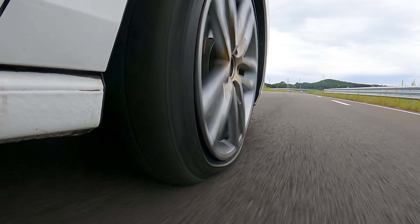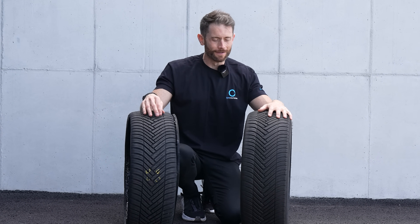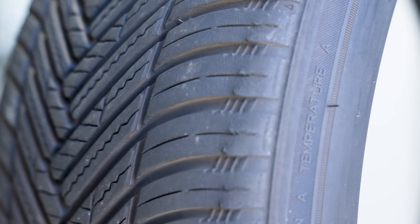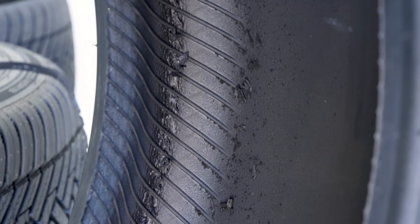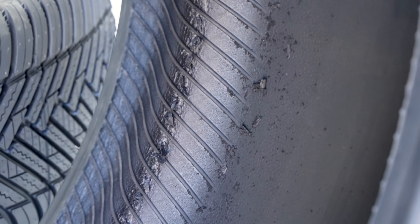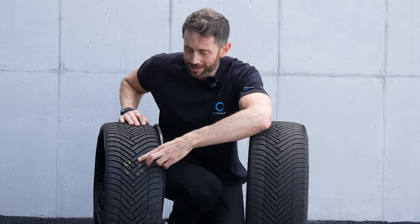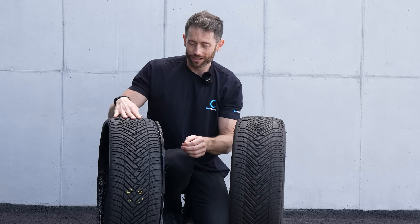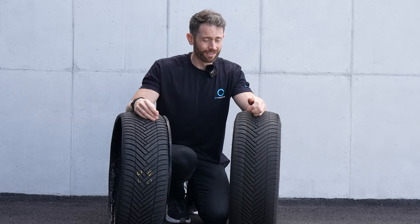I kind of feel like this has made me a bit of a run flat convert. Let's take the tyre off the wheel and look at what it looks like inside next to one that hasn't been run flat. These are the two tyres that sadly died in service - RIP tyre bros. From the outside the run flat still looks fine, but from the inside you can tell why you just can't repair run flat tyres - this tyre cannot be used safely again, I've destroyed it on the inside. This is the seal tyre - you can see the entry points of the nails, and from the inside you can see absolutely nothing; the seal has taken the punctures and just sealed itself. Incredible technology.